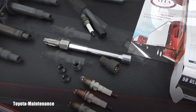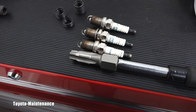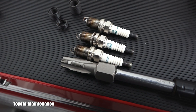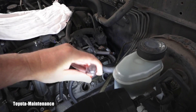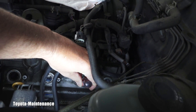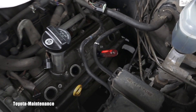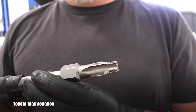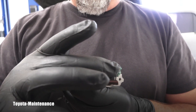I already have a replacement for it — it's approximately the diameter of the tube, so I will insert it and put it on the tool, and that should help. As a precaution I will use a long screwdriver and put it in that spark plug tube to verify the piston is not in the upper position. This one should be long enough — it goes into number five through the hole. I turn the engine clockwise with a 22mm socket and saw the screwdriver going down, so I can confirm I will not hit the piston.